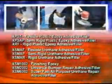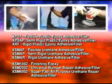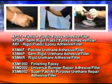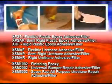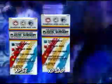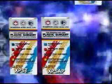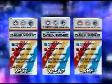Now, below is a listing of products that can be used in the repair stage. The differences in the products listed below are that some are urethanes, primarily for the backside of a repair. Some are epoxies that can be used on both the front and back sides of the repair. XPST, Flexible Plastic Epoxy Adhesive Filler. XPSAP, Semi-Rigid Plastic Epoxy Adhesive Filler. XRF, Rigid Plastic Epoxy Adhesive Filler.